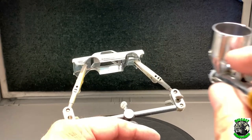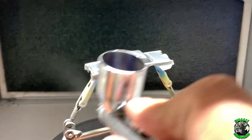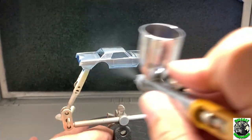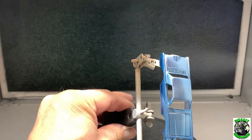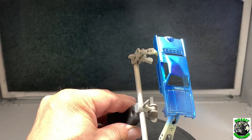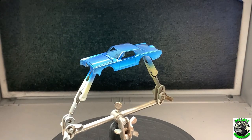Now it's time to paint. I start by applying a few light mist coats just to give the extra paint a nice tooth to bite on. You only want to put a couple of mist coats on there at first — let that dry, or at least let it set up in between. Just enough to put a mist coat on top of the car. When you're mixing the paint, make sure you follow the manufacturer's or distributor's instructions explicitly. This is the secret to a good paint job.